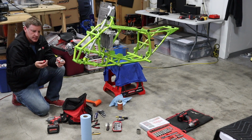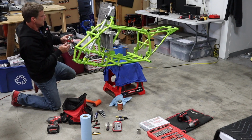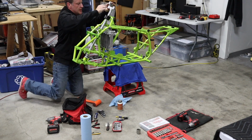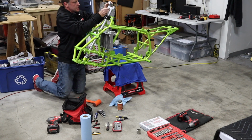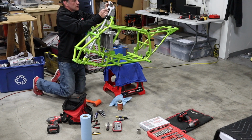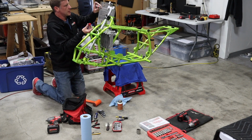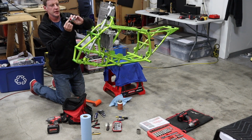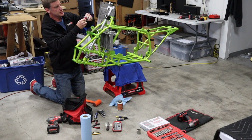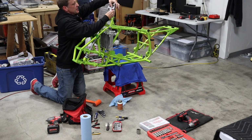These bushings, they're going to help absorb some of the shock. Don't expect to not have any vibration, but anything we can do to minimize the vibration is a plus. So put these in, slide them on. It'll be an inner sleeve, aluminum sleeve. So I just kind of leave that in place. Push it down through, slide the bottom bushing in, and sometimes these are really tight.